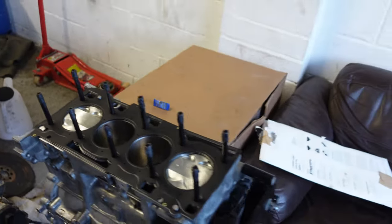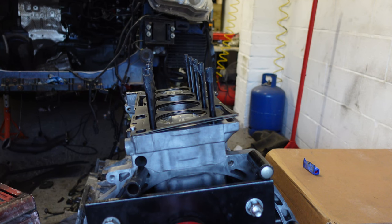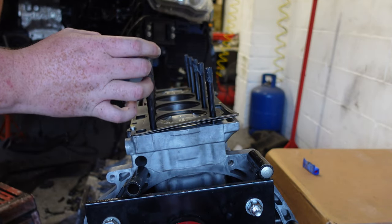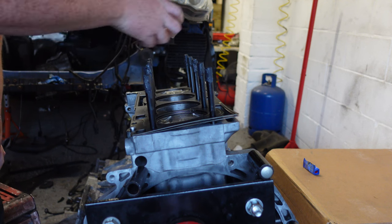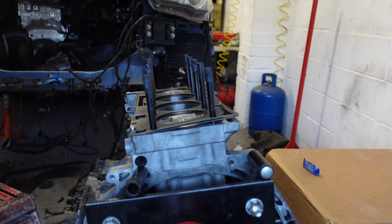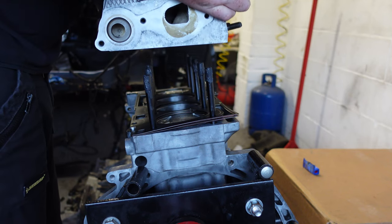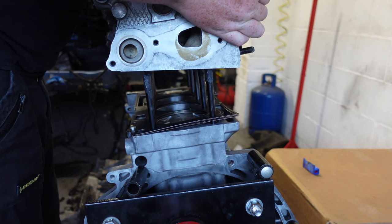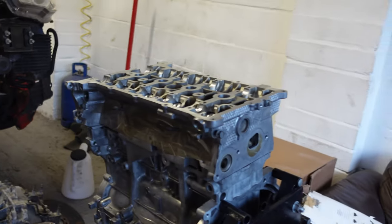One last look at the beautiful pistons - hopefully never to be seen again, hopefully! But you know the way things go around here. Now I'm ready to basically slide the cylinder head onto the studs. I'll just make sure there's no bits of grease protruding too far because I don't want it affecting the head gasket if it gets onto the surface. Okay, here it goes - time to lower the head on.